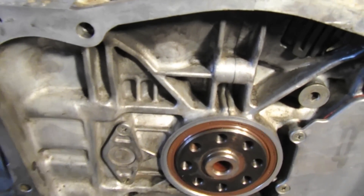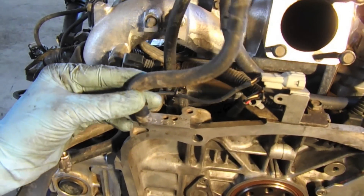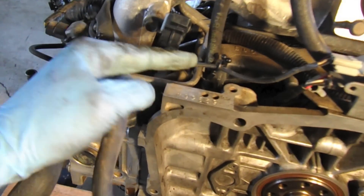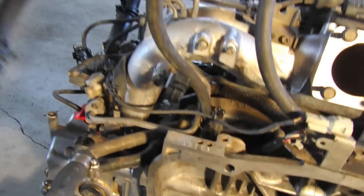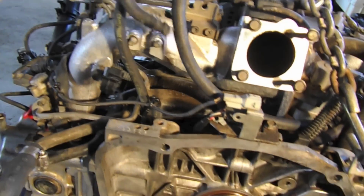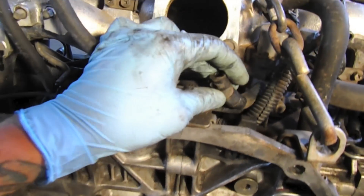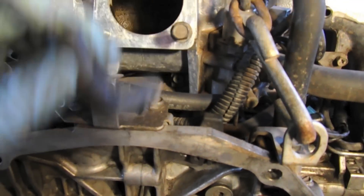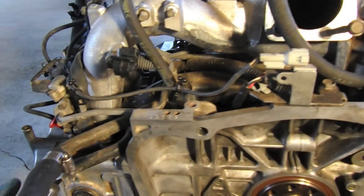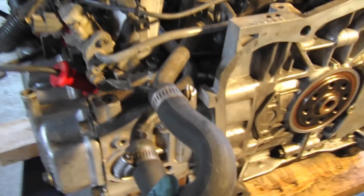The other things I've done in preparation for moving the throttle body include moving the coolant lines. This is the original on this side, and I added a longer extension so we can connect up and cut to length. On the right-hand side it goes from the IAC valve, and I just added an extension on that as well.